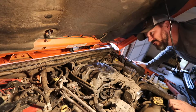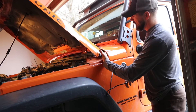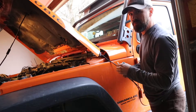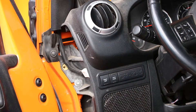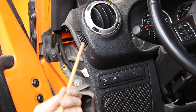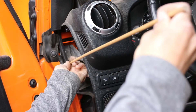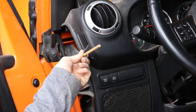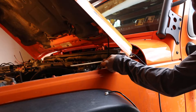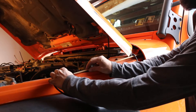I think there's going to be just enough length to get it to the dashboard, and that needs to go through here. There's a channel behind here and a foam plug in the firewall that grants perfect access to the cabin. So what I'm going to do is take this wooden dowel and poke it right through the foam plug. And here you can see it came right through the other side — I will use this to feed my switch through.